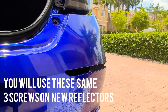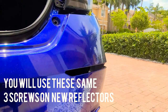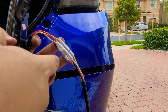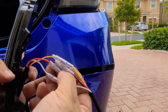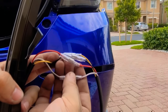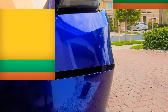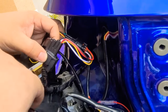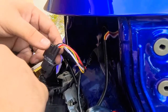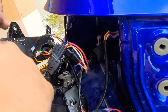I'm going to go ahead and put in the new one with the cable routed up into the taillight so that it's not in the way once we position the bumper back in. I already secured the pigtail — match color-coded: yellow with yellow, red with red, white with white, black with black. Make sure you go ahead and close the waterproof seal. Then we're ready to install. Routed the cable from the bottom of the bumper up here with enough clearance, making sure that nothing gets clipped once I put everything back, as far as the taillight and the bumper go.